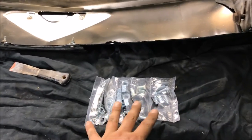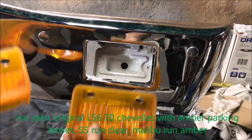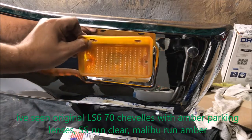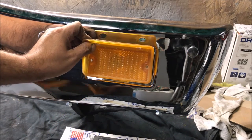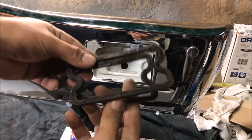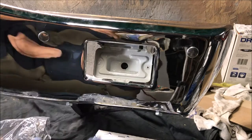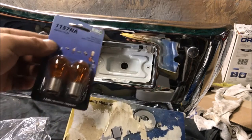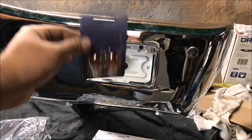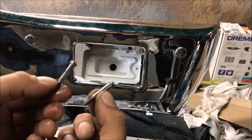This kit does both bumpers — I'll be doing the rear bumper too. For the parking lights, you can get amber or clear lenses. I'm going to run clear on mine, though personally I think the amber look better. The old gaskets just need to be replaced — new ones are about $40. These use 1157 bulbs — your choice of clear or amber. Since these are supposed to be amber lights, you'll most likely want amber bulbs.